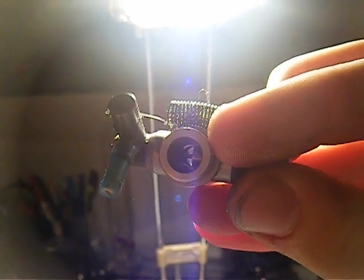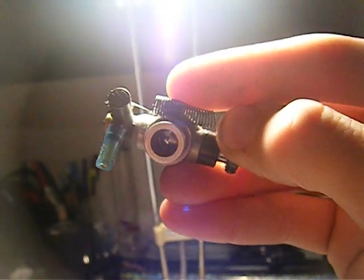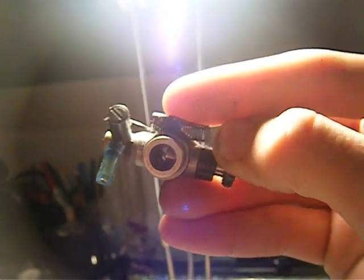That's the low speed. As you adjust it, it moves in or out, and depending how far you accelerate, you'll be opening just that one little pin for a little while. Once you get to about mid-range in this one, it opens up fully, and your high-speed needle is what takes over the rest of the control. So you have the low speed and the high speed.